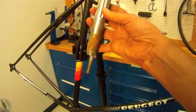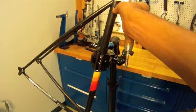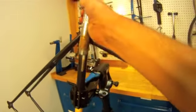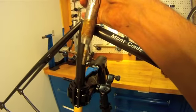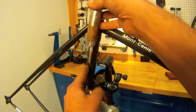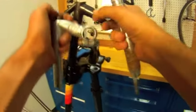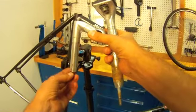I'm afraid we are not going to be able to replace this. We do need this seat post. It's a very unique system here. I'm not sure if it was proprietary, but you don't see it on other bikes other than the Peugeot line that I'm aware of. We have an internal plug inside. It's supposed to be floating. It sits up against the seat post here, much like a stem.